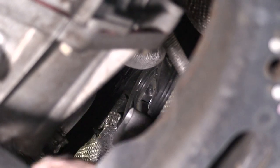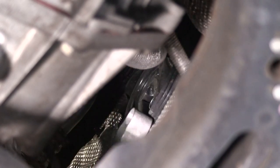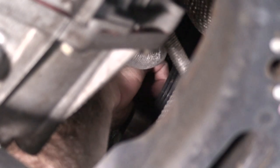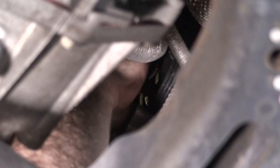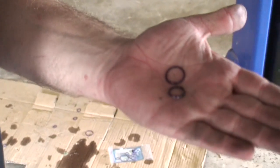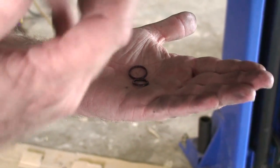So there are two O-rings on each side of those lines. We want to go ahead and peel those out of there. We want to match them up. So this is the top one, and there's a bottom one, and they are different sizes. So now we just want to match those O-rings, lube them, put them on, then we can reinstall the block,